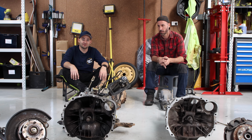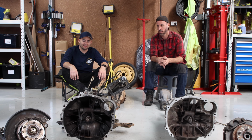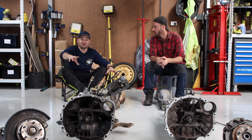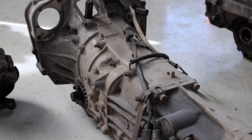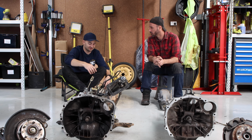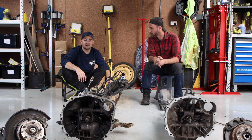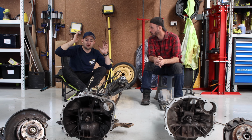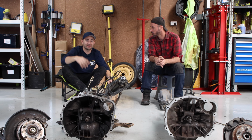So I've blown up enough Subaru stuff to know that this formula is going to work really well, along with the help of very clever people like Mechanical Stig. Back in the day, you would get a 5-speed like that. You'd put billet gears in it that were straight cut, so you sound like a V8 supercar, whining all the time, which is good in theory, but it would actually suck to live with. Then these boxes came out, and everyone was like, oh my God, they're as strong or stronger, and they don't whine, and they're a factory part that bolts in.